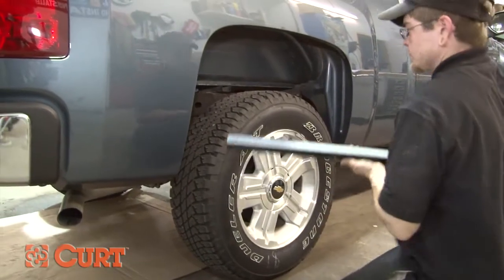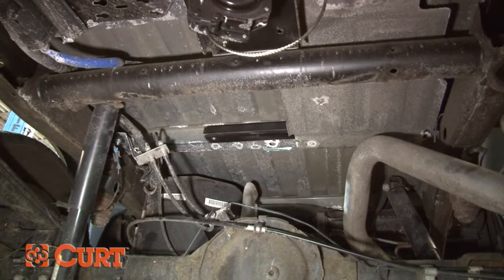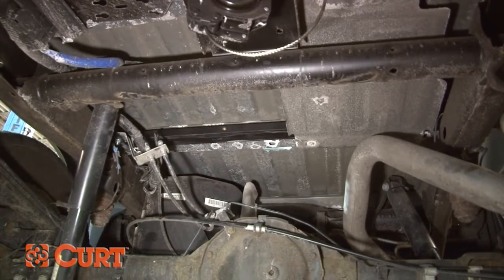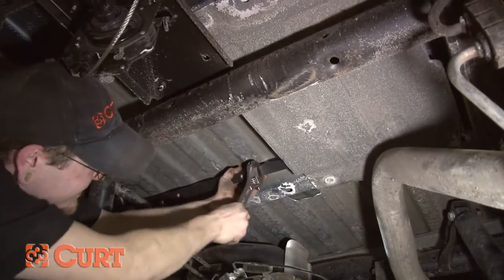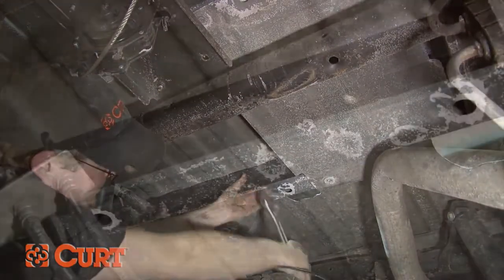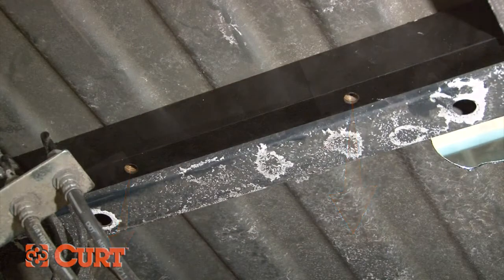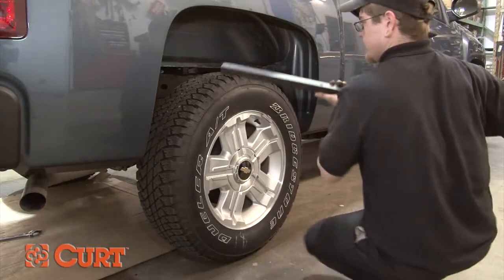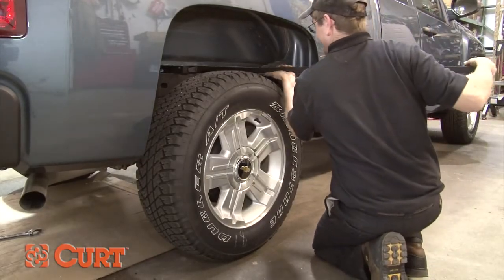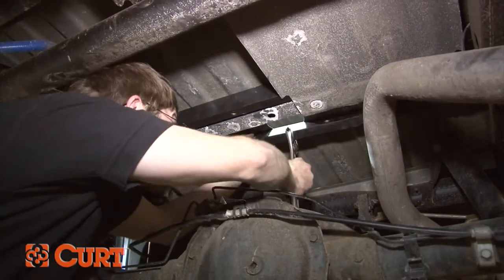Install the rear crossarm by sliding it between the frame and truck bed floor above the passenger side rear tire. After spanning both frames, rotate the crossarm vertically so that the 4 center threaded holes are perpendicular to the ground. On short bed models like this one, the crossarm should be behind the bed rail support towards the rear of the truck. Again from the passenger side, slide the front crossarm across the frame and rotate it vertically so that the holes are towards the ground.